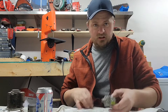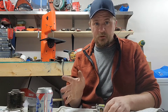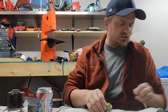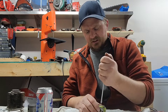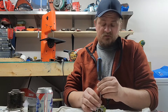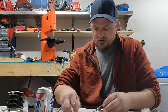This is the only saw I've had with dual carbs in it. I hate Walbro carbs except the WA and WT series — those are perfectly fine to work on. I hate the HDAs and BTCs with a passion. SDCs I don't like either because of that stupid accelerator pump that's hard to find parts for. The bigger carbs — Tillotson HS — that's the perfect carb for saws between 50 and 100-plus CCs in my opinion. They're so easy to work on.